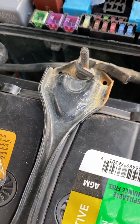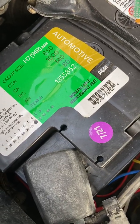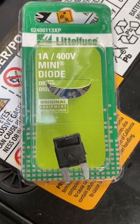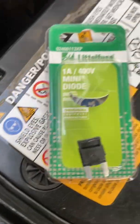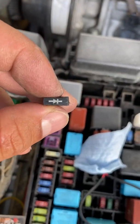The other thing about these AGM batteries is that they're okay normally, but they aren't fully charged if you don't install this diode. GM does make a factory one, and I believe you can use the ACDelco AC compressor diode. I got this from O'Reilly's — it's about five dollars after tax depending on where you are. The most important thing is to install this facing back towards the car, or to the right.